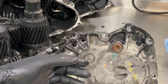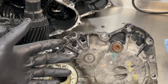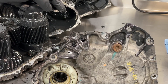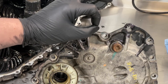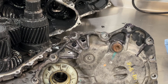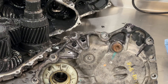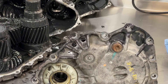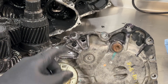The side cover has ribs and is structural to an extent, but a small hole here should be fine. This is also where Ford puts the drain plug on the newer units — the cover is redesigned but they also use the side cover and do not drill into the main case. On newer Fusions, Focus, and Escapes the PTU is totally different with a big boss around the plug for structural support. Since we're retrofitting, go small with eighth-inch. With it being hot — which is when you want to change this fluid anyway — pop the fill plug and the drain plug, and it'll flow right out for a great exchange, way better than sucking it out.